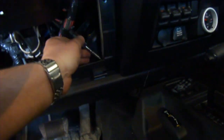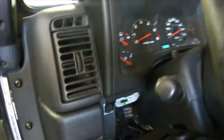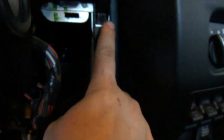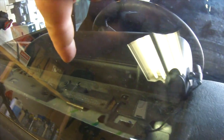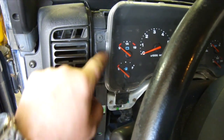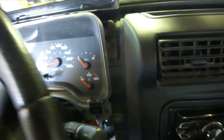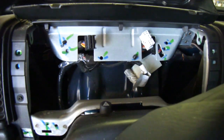Got my soldering gun back! The next step is remove the plastic trim — there's one screw right there, one screw right there, and then three in the dash up top that you gotta remove. The cluster is held in by four bolts — one, two, three, and four — so we're gonna remove those right now as well.